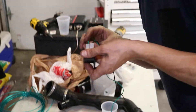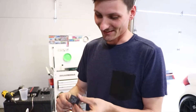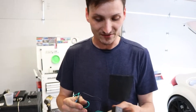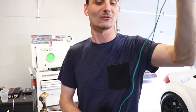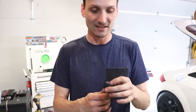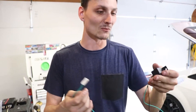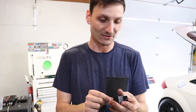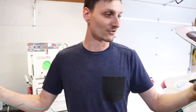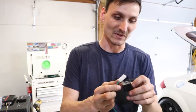Pin 30 here is my power in, so there's my fusible link. It's never wise to run high-current pumps off the factory harness, so what we're doing is taking a signal wire — a switched 12-volt from the amplifier I have in the back — and what that does is flip this relay to complete a circuit that draws power straight from the battery. That'll be its own circuit with heavier wire, so instead of relying on the factory harness to supply power, I don't have to worry about damaging it. Basically, a switched 12-volt source flips a relay to pull power from my own circuit.